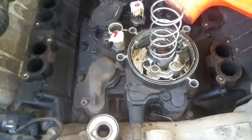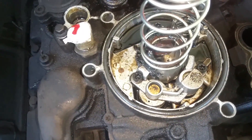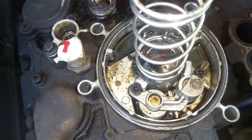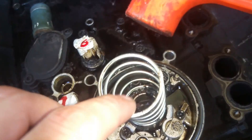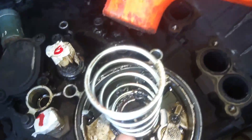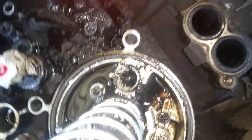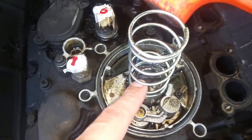After removing a lot of stuff, I started looking around and down in the oil filter housing there's supposed to be a plastic stand pipe. You can see how this got so hot that it's melted that thing and it's just gone — I guess it's all down in the engine as well. It's looking like any hopes of salvaging this engine are gone because it had to get pretty hot to do that.